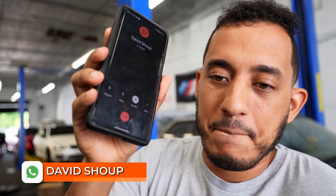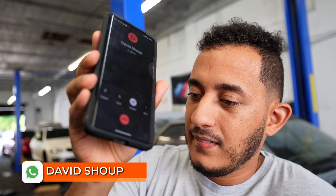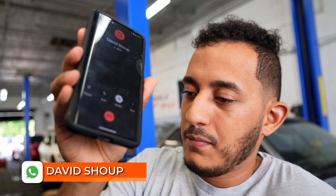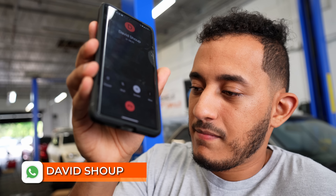From your experience, that's made it a lot easier for you and made the car a lot more reliable for those that own the N54, right? With O2 sensors, replacements and stuff like that. Correct. It's cheaper because now you don't have to worry about burning up two extra sensors. The majority of my clients that make this transition always experience improvements in drivability because the O2 sensor is able to work a little bit better. So highly recommend it — it's one of the best modifications you can do on the car if you've done a single turbo conversion.